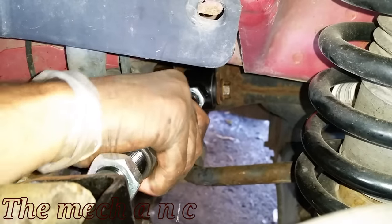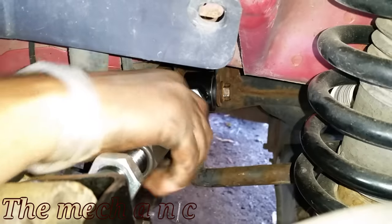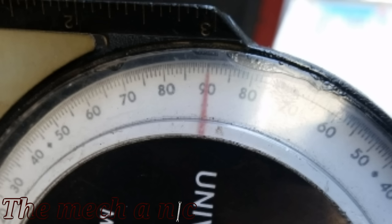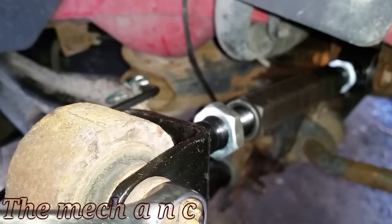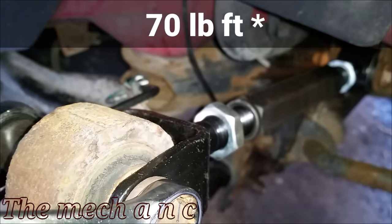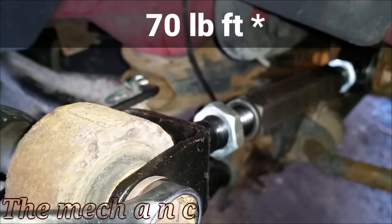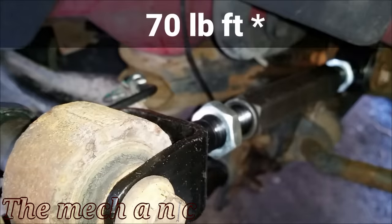The angle is off, so I want to get it as close as I can to the 90-degree mark. I go ahead and adjust the sleeve — and there we go, we have it at 90 degrees. Now I'm going to tighten down all the jam nuts. Anyone paying attention or who knows about this will notice that I made a mistake, which I'll fix at the end of the video — leave a comment if you spotted it.